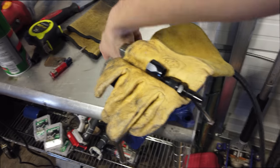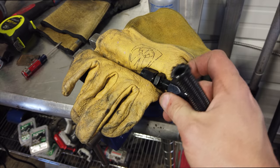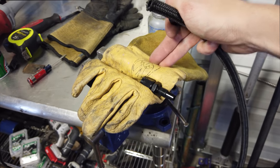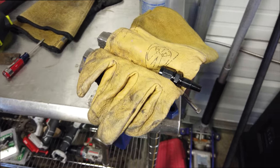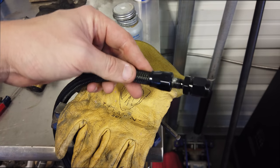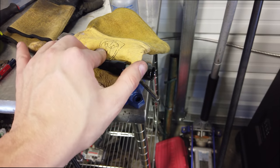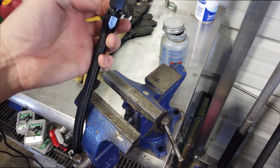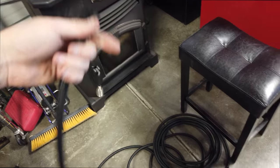What I usually do is put a little bit of anti-seize here and make sure you've got a clean cut on this end of your hose. Then you can work this into your fitting and the fitting will screw on and use this taper to squeeze the line and make it a tight fit. Using a welding glove to make sure I don't mar up the new fitting since I don't have the fancy little aluminum jaws for the vice. So I got the hose pushed all the way in — much nicer than poking your fingers a thousand times with steel braid. This is the first car I've used this nylon hose and I can already tell it's highly worth the money. Now I'll mount this side in the vice and screw the fitting in instead of having to turn the hose every time. After it's all screwed in, you get a complete piece. This side will thread onto the fuel pump and I'll run the long line all the way up to the front of the car, figure out what I need, and cut it there. I'll end up pulling the line back off and cleaning it all out before final assembly.